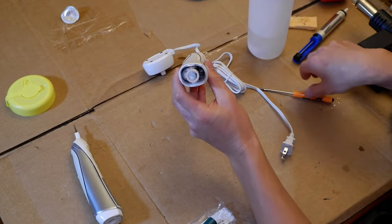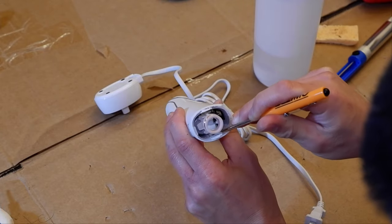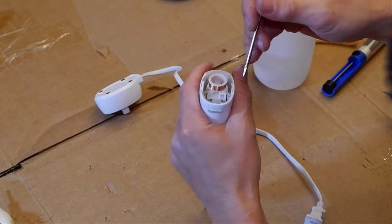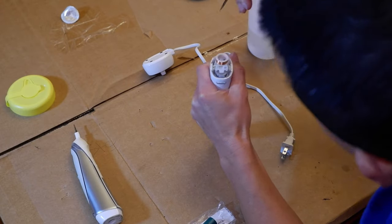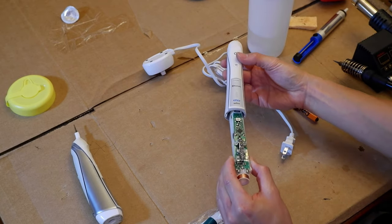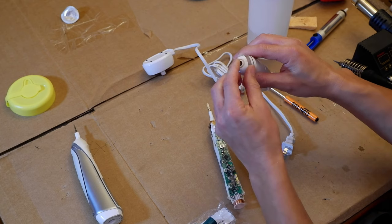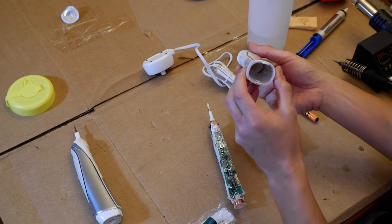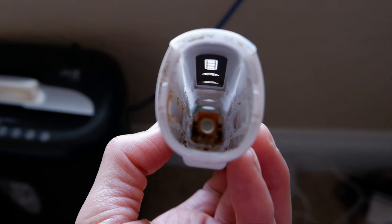Now that everything is loosened up, look inside — you'll see two little retaining clips on either side. Pop them inward out of the way. The easiest way is to put it on the table, apply a little pressure, pop it up to release the clips, and slide the whole internals right out. Once out, this one is full of gunk inside and there's evidence of leaking — the top rubber part must not have sealed well, so I'll soak it to clean out the inside before reassembly.